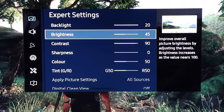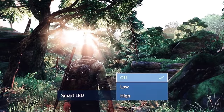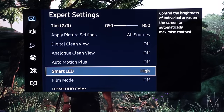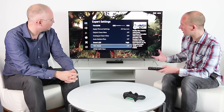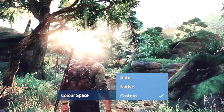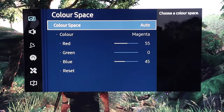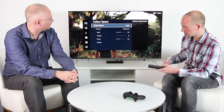In order to get peak brightness of a thousand nits you have to have the backlight at its highest. Now I am seeing the difference. The other settings you should enable for HDR to get the maximum dynamic range: Smart LED — which is the dynamic backlight — should be set to High, so in dark scenes the backlight will dim and you get those important dark black levels. Color Space you also want to adjust to Auto if you're not going to be calibrating the set, and that will put the TV into the wider color gamut mode and enable it to track the DCI color space correctly.